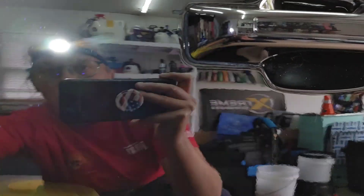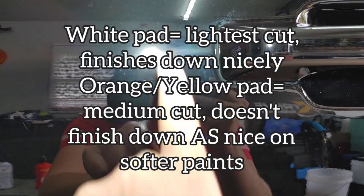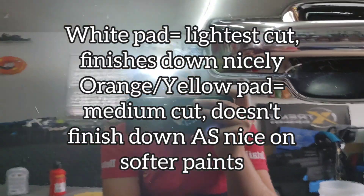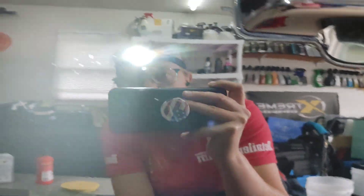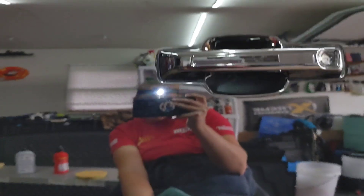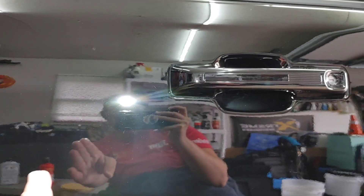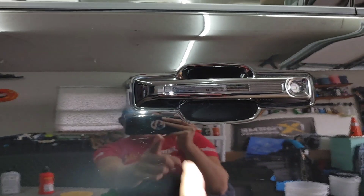When I come in over here, you can see we've got nice clarity. Right here, I stopped with my yellow pad and correcting cream. It did a decent job of removing the deeper swirls on the paint quickly, but it kind of left this haze on the paint. This paint just does not want to finish down properly. So I'm having to go a second step to give me that clarity without that haze. If we come in with our light, you can see right there — there's the haze. So there's a difference between the polished area, the haze, and then the unpolished part over here.